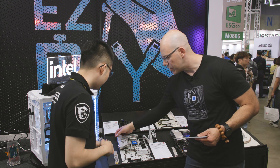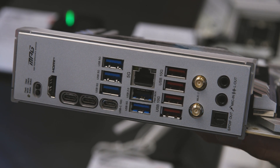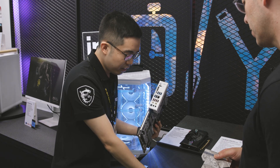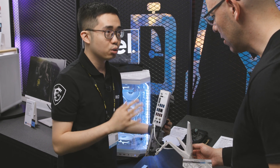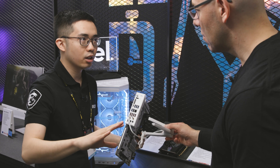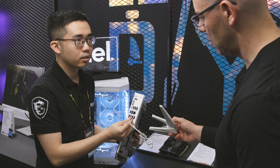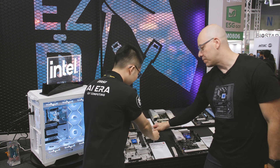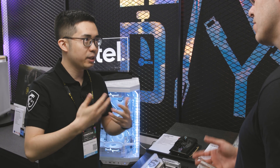For the AIO, we have a new Wi-Fi connector called Easy Antenna. Back in the day you had to screw in the cap for the Wi-Fi, but now it's just a simple slot in. It's secure, and the new base is magnetic so you can slap it onto your metal case and it'll just stay. If you don't want Wi-Fi, a simple unplug does it. Also there are a bunch of new USB-C ports in the IO — lots of new generation IO to speed up large file transfers.